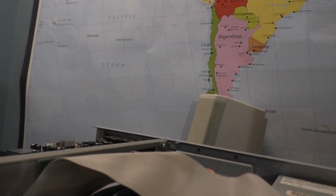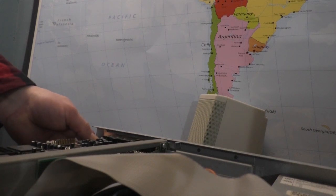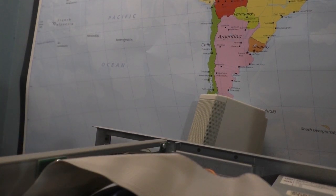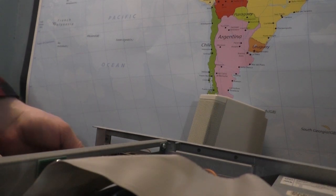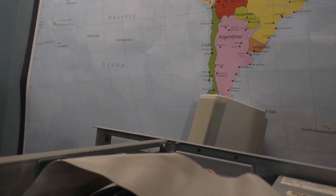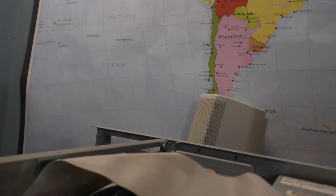Video memory on this system can be brought up to one megabyte through the installation of little memory chips — I believe they're SRAM chips — and it was an easy procedure that anybody could do with just a little patience. Now on the system I had back in the day, it used the same logic board, same board but a very different case, and we've got to remove all the expansion cards. We don't need the modem, we don't need the NIC.